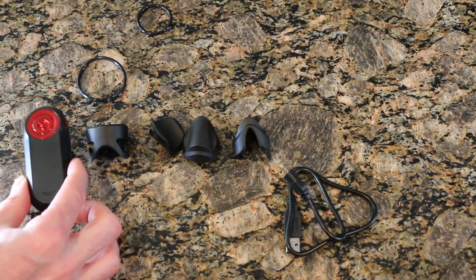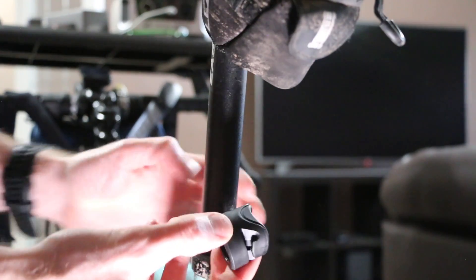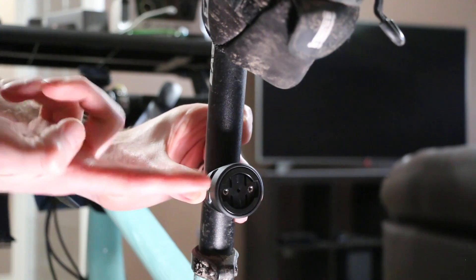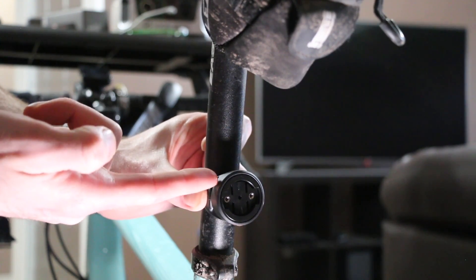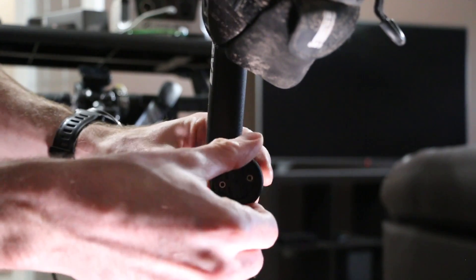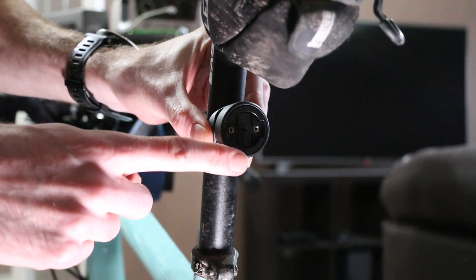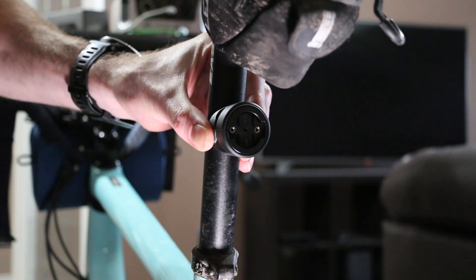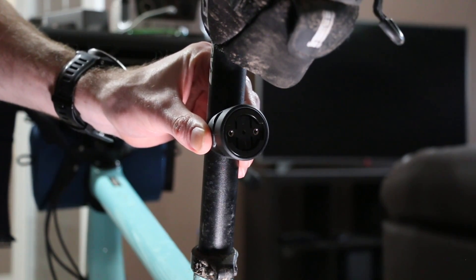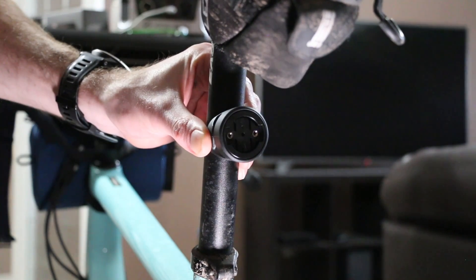We have the regular mount and we're going to throw this on the seat post. There are two ways to put it on — level pointing straight back, or upside down where the mount points down. We want the mount right-side up so it points straight back. We're going to position it relatively high — the main thing is we want a 15-degree angle so that the radar doesn't actually hit the back wheel. The user manual doesn't specify an exact position, but fairly high is the goal.